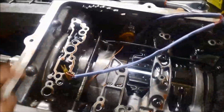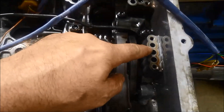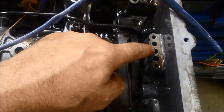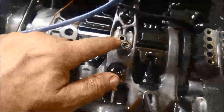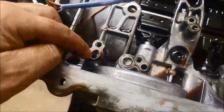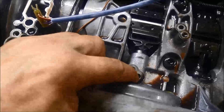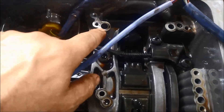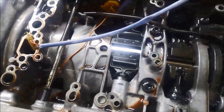If you're doing this in the car, this is the point where you do an air pressure test. C2, C4 — just be careful not to put full pressure on the C4 clutch, that's the smaller clutch. You've got your C3 clutch, and your C1 clutch up here. Then you've got the outer seal applying that servo, the smaller seal, and the same on the rear band — the outer seal and the inner seal. Just make sure there's no air leak sounds when testing them.